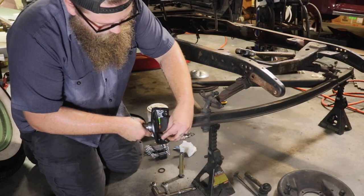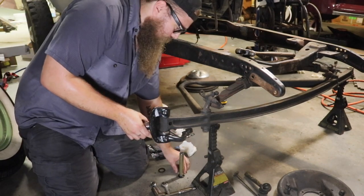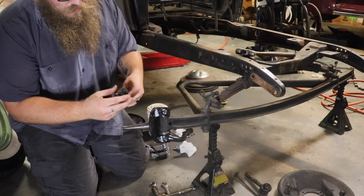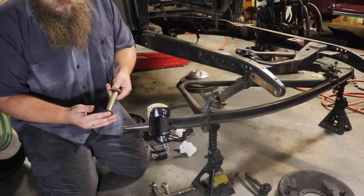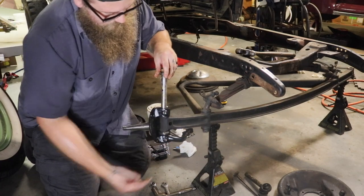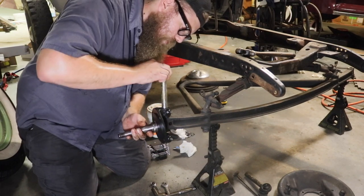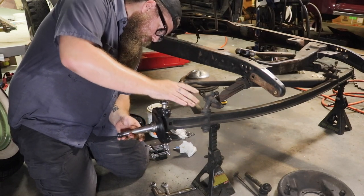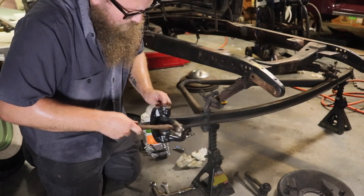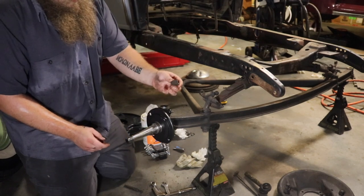I'm going to go ahead and put the bearing in — slide this in here. This is the old bearing; I've got a new one on order, I just don't want to wait to keep the car from rolling. Now on the top here we're going to have a washer that's going to hold this felt in, so let's put this washer on. This felt just keeps dirt from getting into the grease. Go ahead and slide this through, and this keeper right here is going to go towards the inside of the axle — make sure you spin it so the keeper notch is inside the axle. It's kind of a pain to line that up after the fact, so I want to line it up as soon as it goes straight down in there. That should slide in pretty easily — a little tap if need be. If you have to hit it too hard, it's not lined up and you're messing up your kingpin, so don't whack the crap out of it. Put my little retainer nut back on.